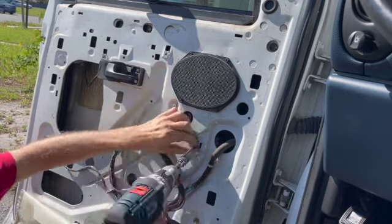The three holes I just showed you — there are three punch points there. If you just need to change the motor and you don't need to change the regulator, you can drill three holes right where those punch points are with a hole saw, and then you'll have access to the bolts that hold the motor to the regulator. You could change the motor without changing the regulator if that's your only problem. But more than likely you're changing the whole regulator and motor. Then thread through the bracket on the glass — not through the glass, just a bracket on the glass.